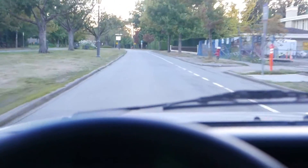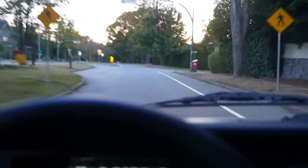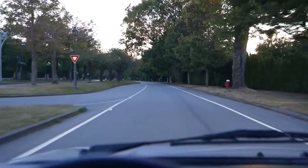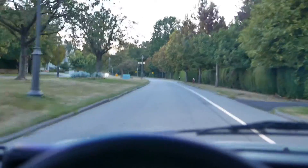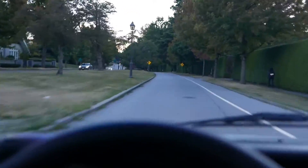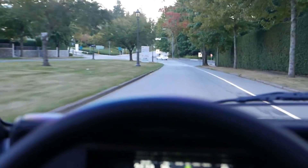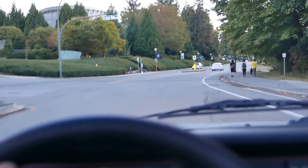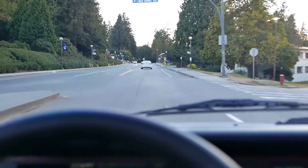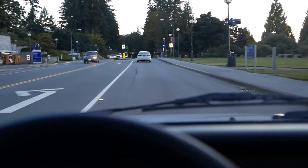What a sound - it's something else. I'm super happy with this thing. I'm going to make lots of little changes but that's what the process is all about - tweak, tweak, tweak. We've got the steering rack sorted out, the brakes bled and broken in, and these are really grippy Direzza 2 tires on 185/60-14 rims - a huge stick for a small tire patch. If I put the catalytic converter on it'll get a lot quieter, and road manners won't smell quite as much either. I'm running 15:1 to 14.8:1, but you still get a little fuel smell that'll go away with the cat converter.